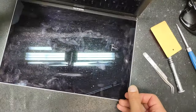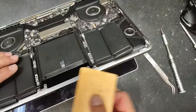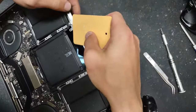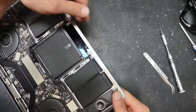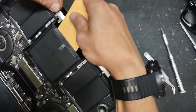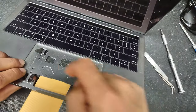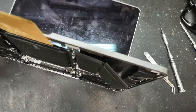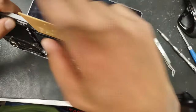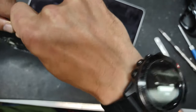This is how the computer looks right now — you can see the battery on that side, and now you can work a little bit better. Don't close it because you might hit the screen. Keep it somewhat at an angle so you can see where the pry tool goes in and make sure it goes in between the battery and the side of the computer — you can even keep it at a 90-degree angle and work your way down with no risk of damaging the screen.